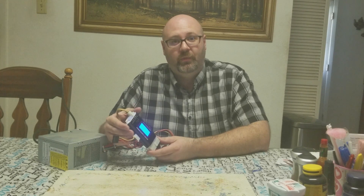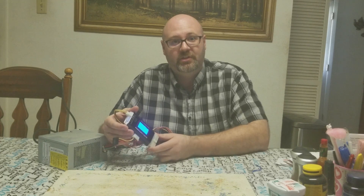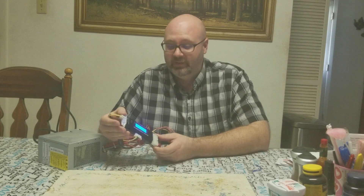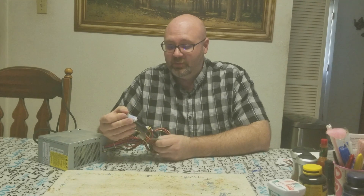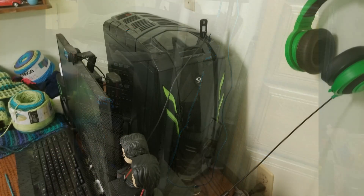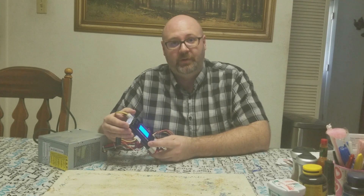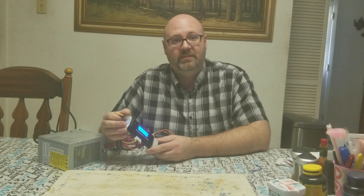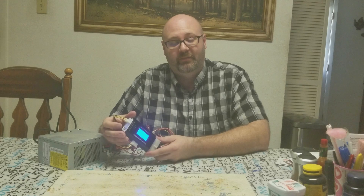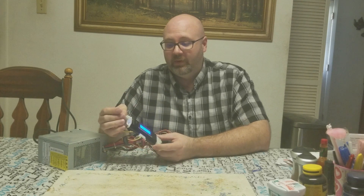I was able to return it because computer parts usually have a good few-year warranty. So if you're building a budget computer, buy one of these to make sure it works before you put it in. I've built three computers — mine, my brother's, and my wife's — and the only dead-on-arrival power supply was the one for my own computer. Testing has always saved me time and frustration, so it's definitely worth the $14. I'll put a link in the description.